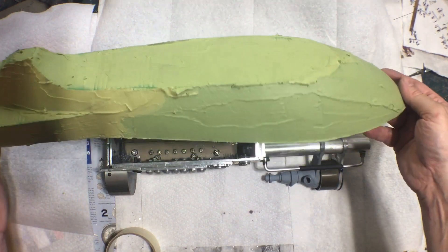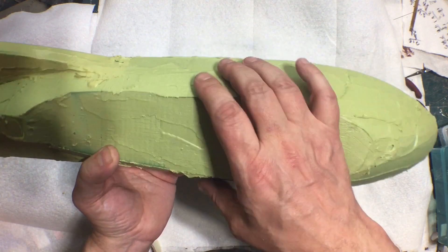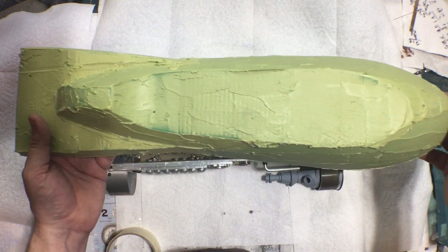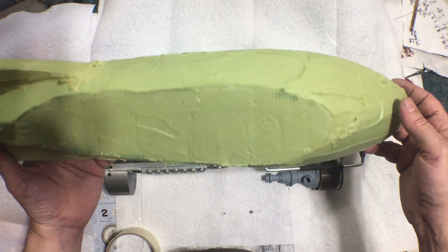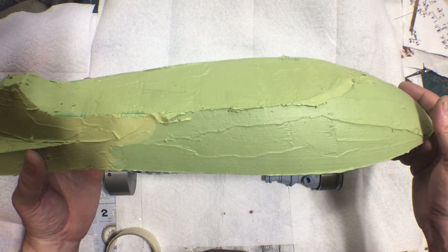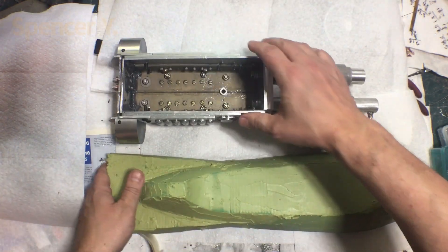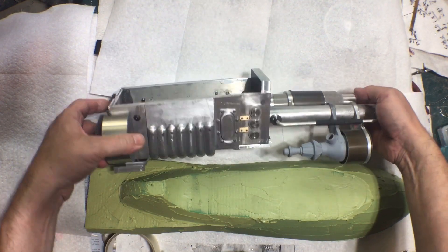Here it is after the first coating of bondo - it's kind of thick and messy and not perfectly cured, still feels soft. Once it's fully cured I'll sand it all back smooth and probably have to do it again. Each time you do it, it gets a little bit smoother, and once it feels fairly smooth I'll do a coat of primer. Once you get primer on it you can tell if there are any other little defects or pinholes, then put some glazing putty on it - but that's going to be a really long drawn-out process. I'm going to end the video here. When we get to the next video, hopefully this will be ready for primer and paint, and then hopefully we can lay up some carbon fiber. I'd like to thank my patrons - thank you very much - and until next time, thanks for watching.